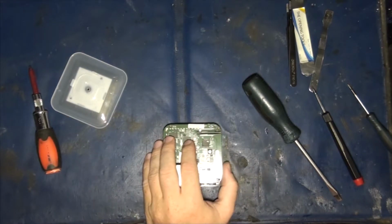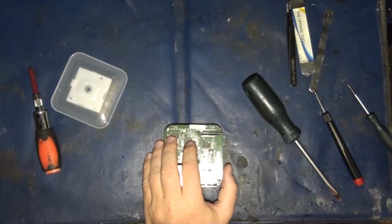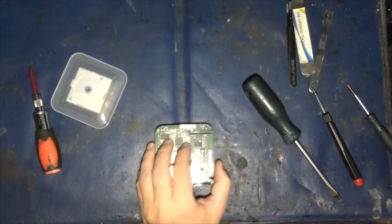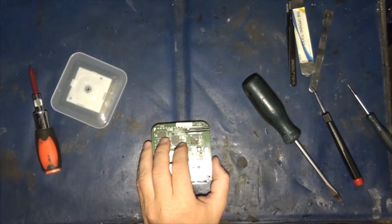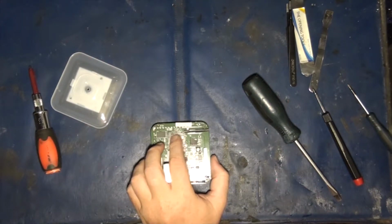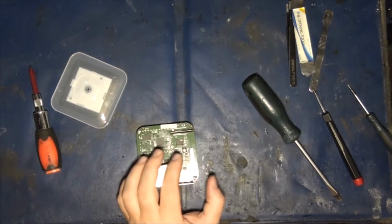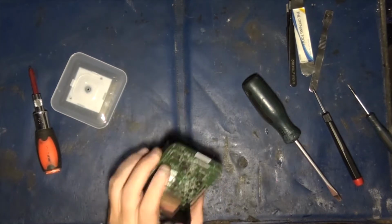Wi-Fi standards, 802.11n, ABG, peak speed, 300 megabits per second. Channel utilization, 20x40, MIMO 2x2 two stream. Ethernet, 10/100 only. USB 2.0. CPU is actually 650 megahertz at peak. Memory speed is 300 or 200 megahertz. DDR1, DDR2. As far as supported interfaces go, it's got UART, which is your serial.